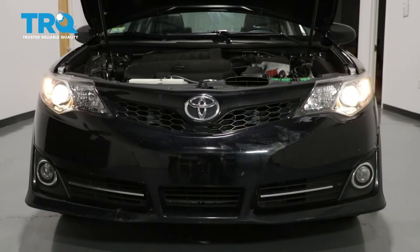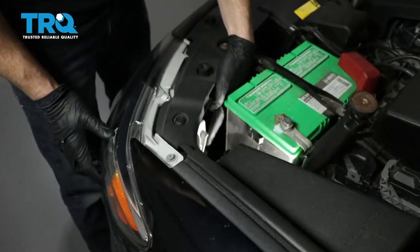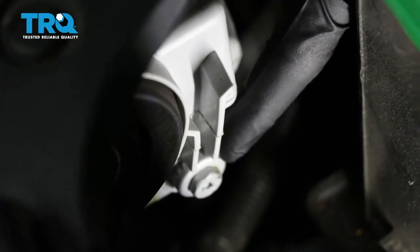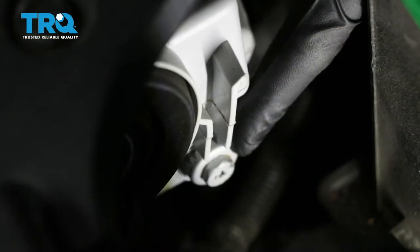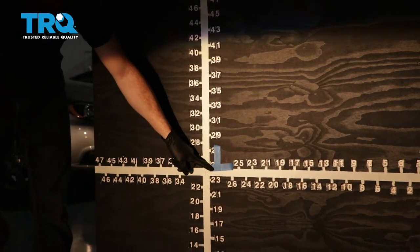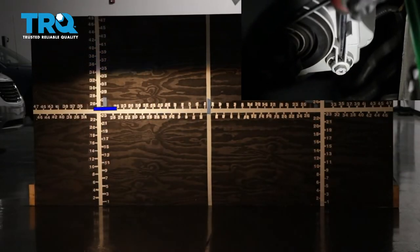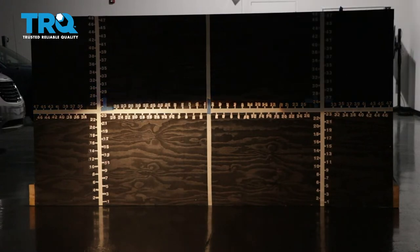To adjust the driver's side, we're going to cover our passenger side headlamp. If you look at the backside of your headlamp assembly, you're going to see the adjustment. Some headlight assemblies have one, two, or even more of them, but you should at least have one — this is how we're going to adjust the headlight beam. We're going to lower the top part of the beam down to just below this line. When you turn the adjustment to the right, it brings the beam up; turn it to the left and it brings the headlight beam down. This is the case on most vehicles.